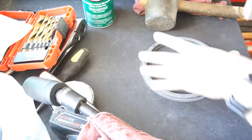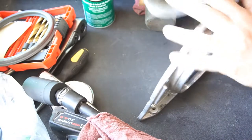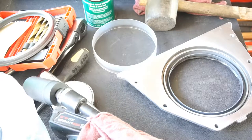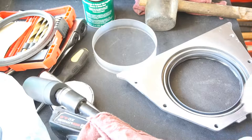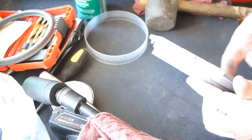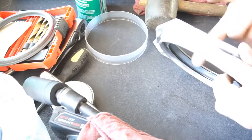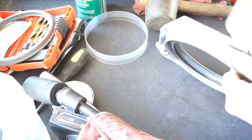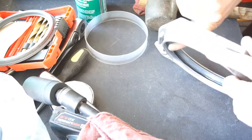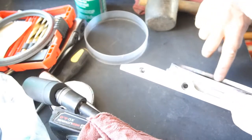What I like to do is take the alignment tool off and put some grease — some oil or something — on the seal, just in case, for the break-in process. I'm going to add some of this blue lube to it. This way when it starts up, it won't tear and it won't stick to the crank. Just going along the whole edge of the seal.